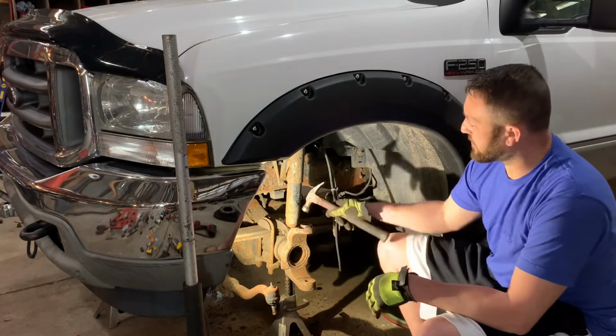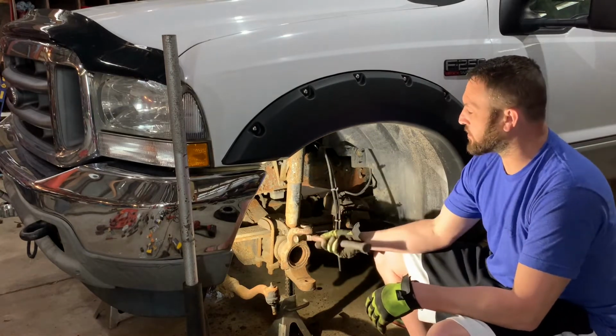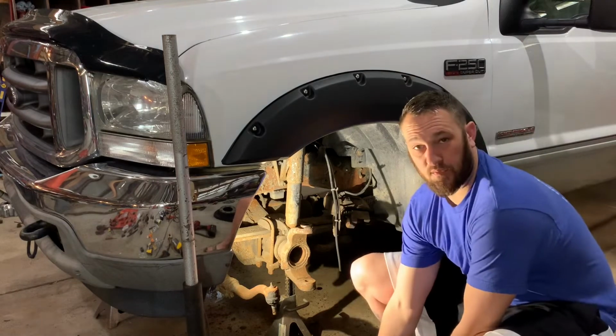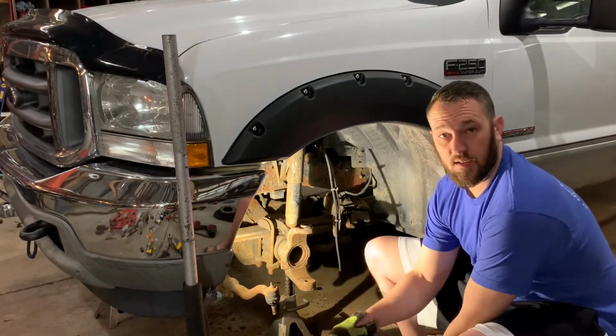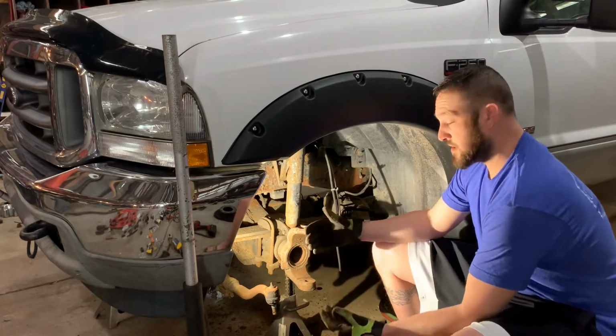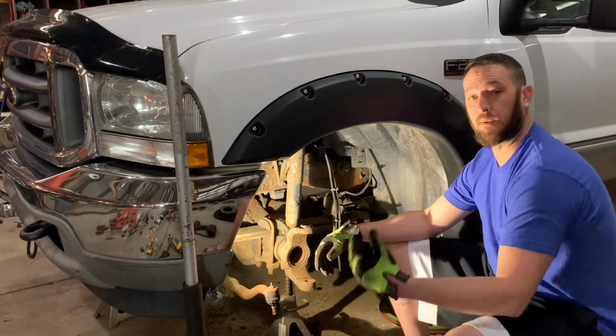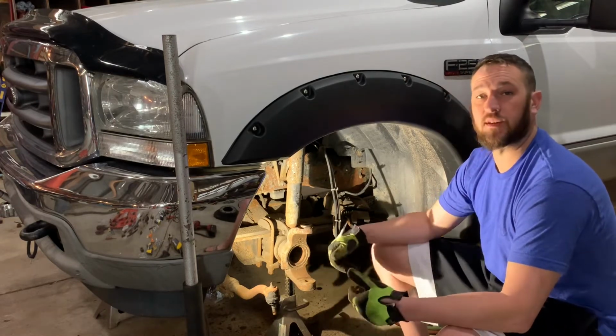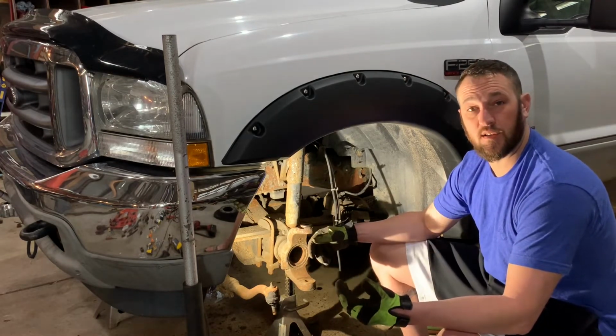I always make sure they're loose before I install the new ball joints. After cutting up quite a few ball joints, I know that the weight of the vehicle is taken up by the ball joints as downward pressure. So when we put this knuckle in place, we're going to take a floor jack and jack it up to hold it so it's snug.